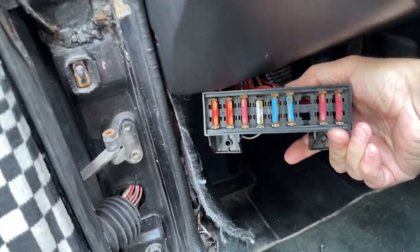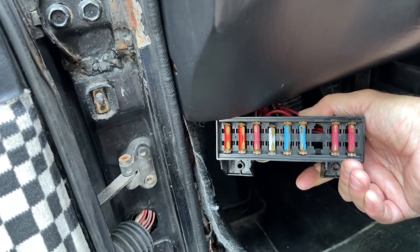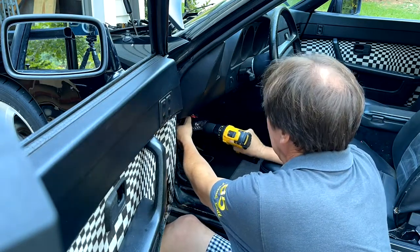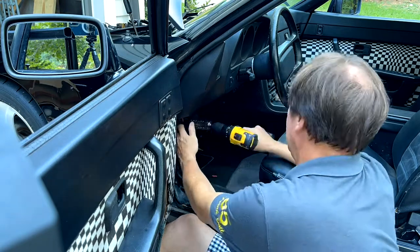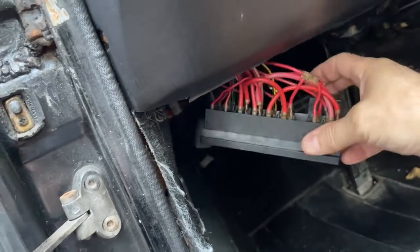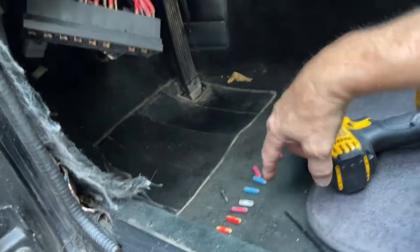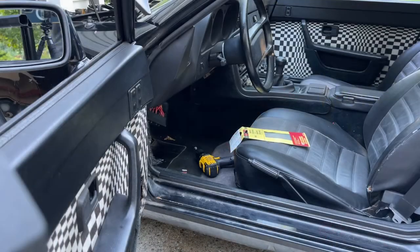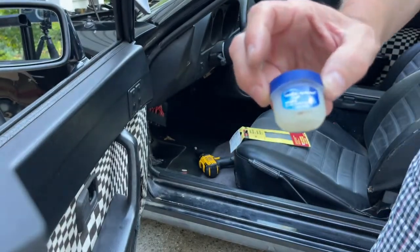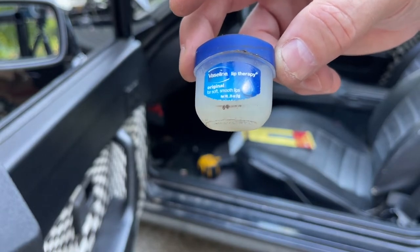Got all the fuses out for the most part, except for the blue one and the one on the far right — everything looks pretty good. I'm going to pop all these out and clean up all the contacts. All the contacts are cleaned up. I bent them out just a little bit to make sure I could get some more contact on the inside. We've got one fuse here that's completely bad. I'll go through the bottoms of these and sand them lightly with some 1,500 grit sandpaper. I couldn't find the dielectric grease, but the next best thing is just a little bit of Vaseline — a tiny bit on the contact surface to increase the contact.